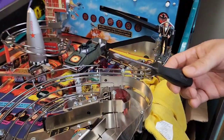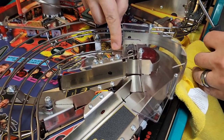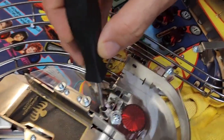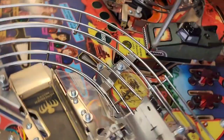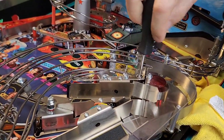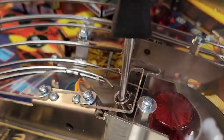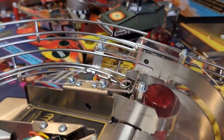So you're going to grab your Phillips head screwdriver — hopefully with a magnetic tip. If it's not magnetic, come in and take these two screws out and remove this plastic, because the screw we need to access is down in here. If you were good at playing Operation when you were a kid, you can go through this hole in the plastic and just undo that screw — again, if you have a magnetic screwdriver. Okay, I just got it loose, so now I'm going to slowly bring it up and out. I'm going to put that screw in my magnetic dish so I don't lose it.